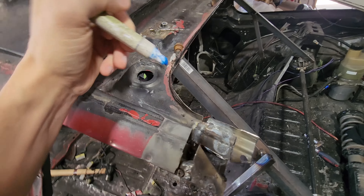I outlined the overlap line onto the chassis — this is our overlap line for the quarter panel, not a cut line, so I'm going to hash it. Since I won't be able to weld this panel from the back, I'll cut it just below the outline of the quarter. We'll also have to drill out the spot weld in here. Now that the quarter panel is trimmed, I want to fold down the edges so the new quarter panel will sit flush on top and I'll be able to weld it recessed. Eastwood makes this tool that folds the panel at just the edge — basically a custom vice grip. You don't need this specific tool; channel locks or something similar would work. This is not sponsored — I just like the tool.